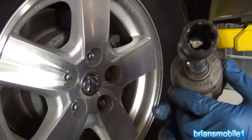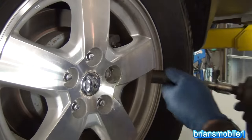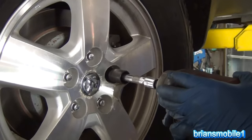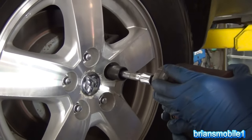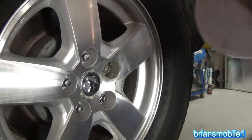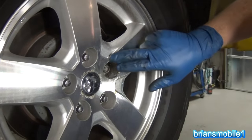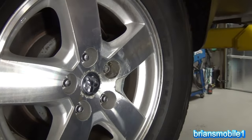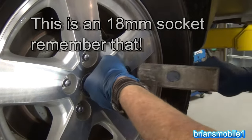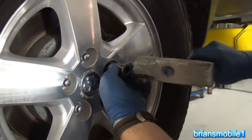So I'm gonna use the right tool for the job, which is an extractor that grips it without crushing onto it. Well, the paint's for shitzled. Looks like we're, oh, nope, that gel's working. Burning the gel, but not the tire. That's good. Another thing that you can do is take the socket and hit it onto the base of the nut. Break up any corrosion.